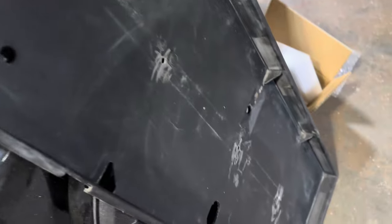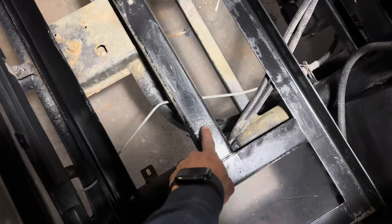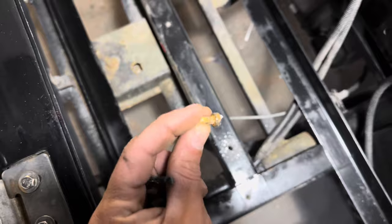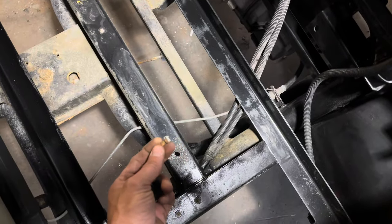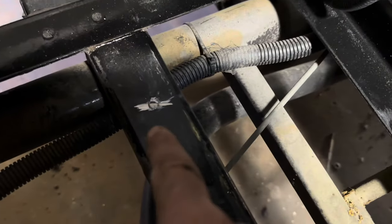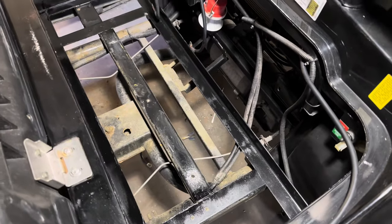They were pretty corroded, so the tray is nice and flat now. I removed the tray because when I cut them off, the bottom side was also heavily corroded and I needed to drill these out. I drilled this one out and I'm about to drill this one out, so we can put the plastic insert back in and mount the battery through those holes.